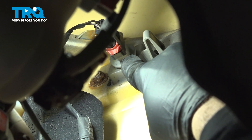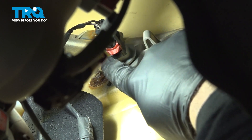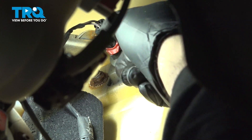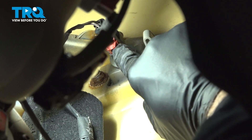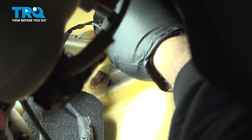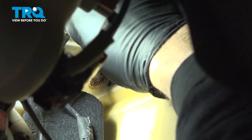Now on the back side of the bumper cover here, you're going to have access to the wire harness that goes to the bulb and your marker light. There is a red lock tab right here — go ahead and pull that red lock tab back, and that is going to unlock it. Now there's a little spring tab or clip right here; you can press this and wiggle that connector off.